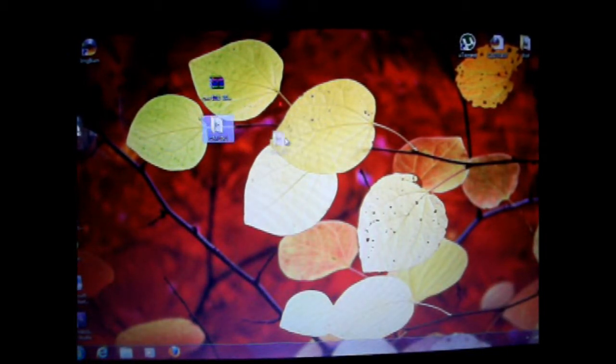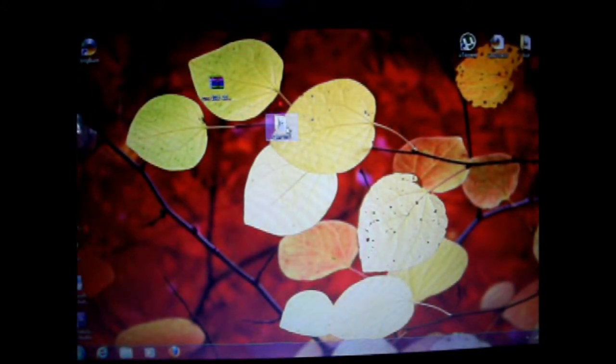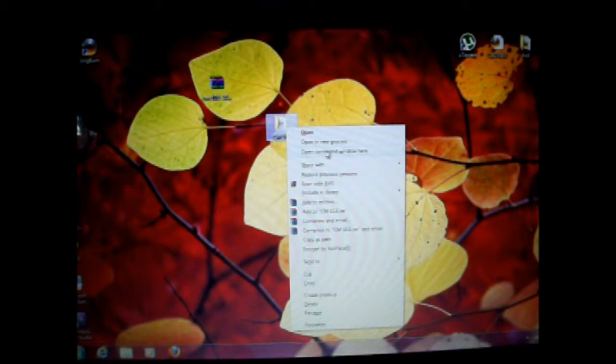And then that folder that you have the boot file in, you're going to hold shift and right click on that, and you should get an option that says open command window here, so click on that and it should say wherever you have the folder and then the name of the folder. And I'm going to zoom in, hopefully you can see this. You're going to type in fastboot. I'll have this in the description because you can't really see it.